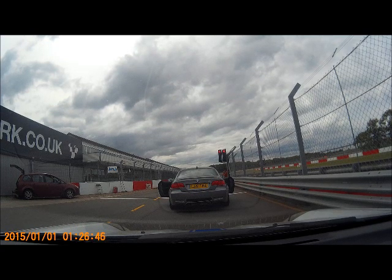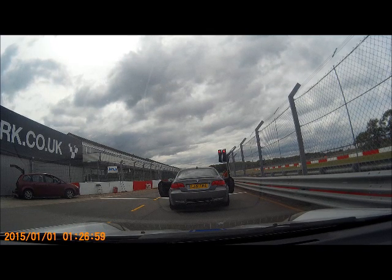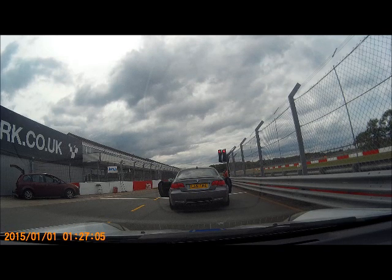People use them all the time, obviously, but what you tend to do is dial it out by making the front end that bit grippier, that bit more compliant. But no, I would stick with it as it is, if it's actually catching you out. Well, it was on the 1ZZ. It hasn't on this as of yet. Ah, right, okay. So on that basis, I can stiffen up the back a bit more.